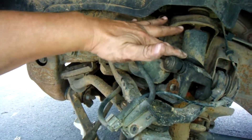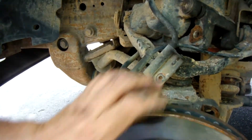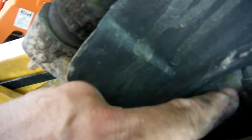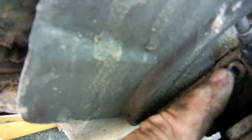I've removed the brake caliper and the bracket that was holding it down. Set the caliper back here. I'll just take the rotor off. And that right there is the ABS wheel speed sensor. There's a bolt right there holding it on. I'll loosen that and then gently twist the sensor back and forth to loosen it and then pull it straight out.